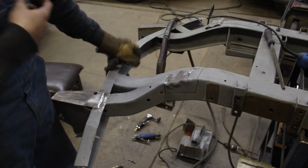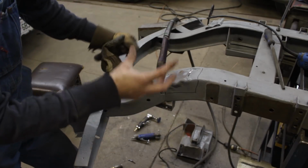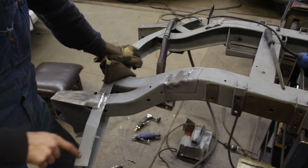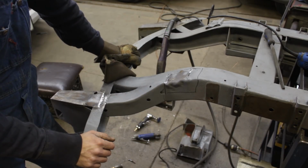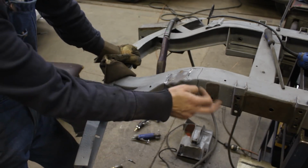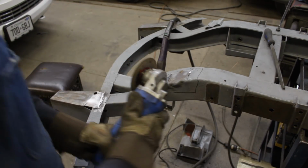if I cut like this, there's gonna be two sides and three corners that are gonna be keeping it from twisting. Plus the suspension is on this side, so if anything gets twisted, that's gonna be the front end here, which holds the bonnet. So I don't think if it gets twisted by 1/16 of an inch, that's gonna be too much of a difference. It's important here, where the suspension is. I'm gonna cut it out. Don't be mad at me, okay?